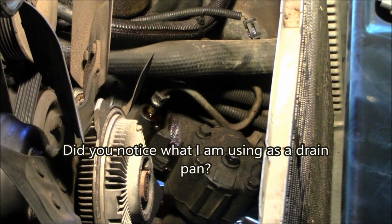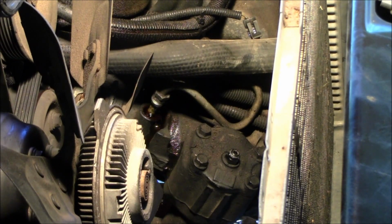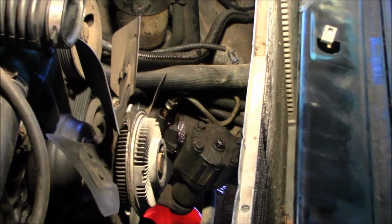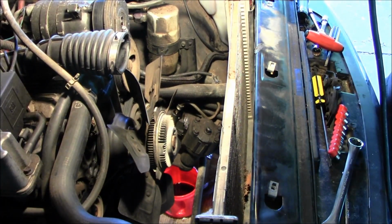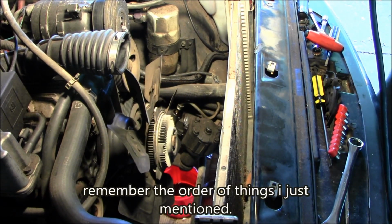All right, so now I'm gonna take off the pinch collar on the steering column, and then we're gonna disconnect the center link, and then we're going to take the 3 bolts out of the frame, and that baby should fall right out. And just set it off the side, take a look at it.